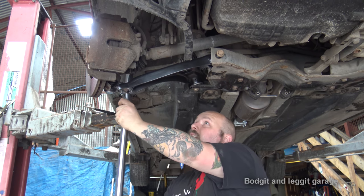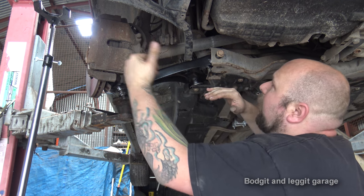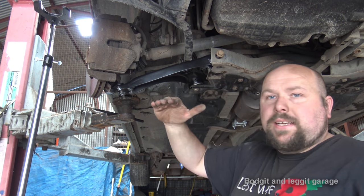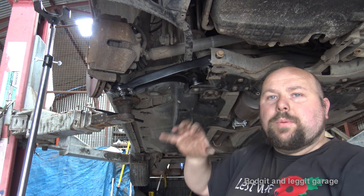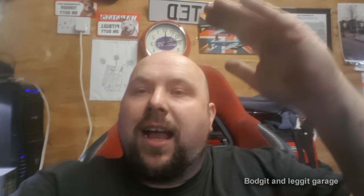I can now release all this. You see how much that came down? That came down a few inches. So I'm going to use the Hubmate, lift this up level, and then tighten these two bolts — because that means our bushings, when the car is down and level, if we were to tighten them now it would twist our bushings up and put more pressure on them and they'd go quicker. So we do it that way, they'll last longer — it's the proper way to do it. The wishbone is there supporting it and the back two bushings stop the whole thing going down. If the wishbone wasn't there it would have dropped a lot further, which means I'd have had to put more pressure on the wishbone. When you put the wishbone at an angle the back two bushings don't like to go in. This supported it, stopped it going down that few inches, and the wishbone just slid in so much easier. I was amazed it just went in like butter.